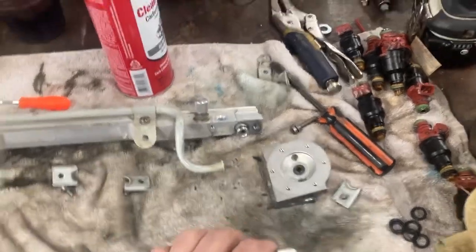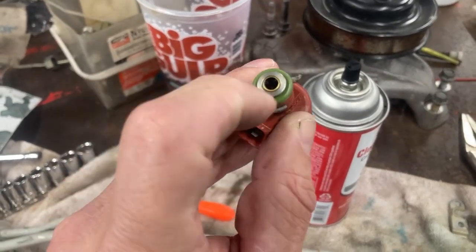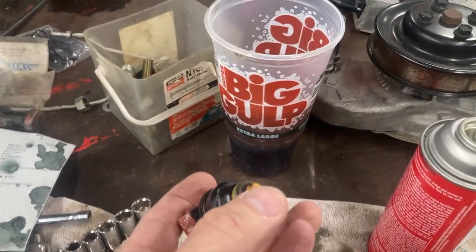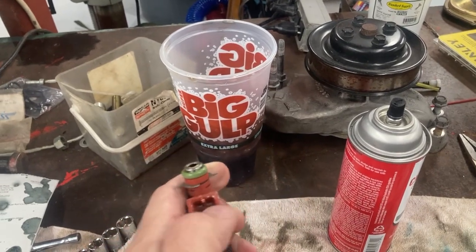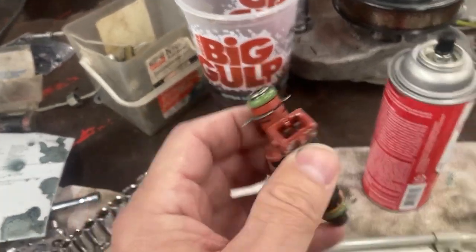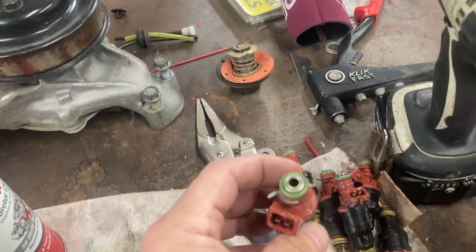When this goes back together it'll be just like it was. On injectors — a lot of these have a little screen in the top like this. To clean them out without sending them in for service, put power to them with a 9-volt battery — that'll open them up. I actually use a power supply set to about 9 volts. Hold it open and spray carburetor cleaner through them backwards to clean the screen, then forwards, and run air through them while they're open. You'll hear them open and close — pop pop pop — simulating the injector running. Running 9V DC through them won't hurt them.